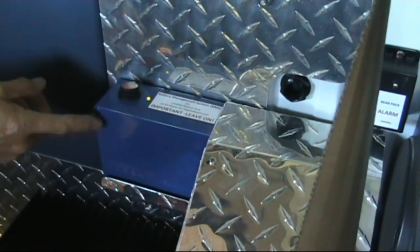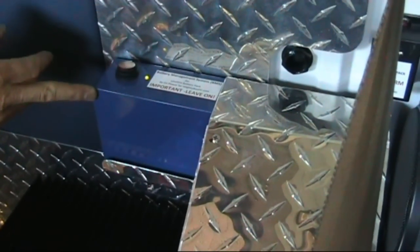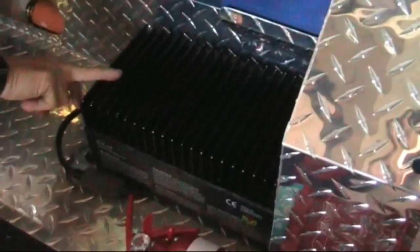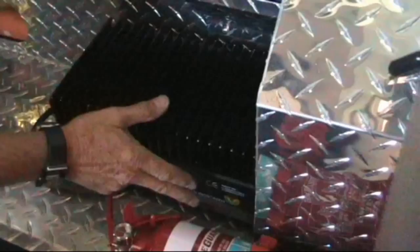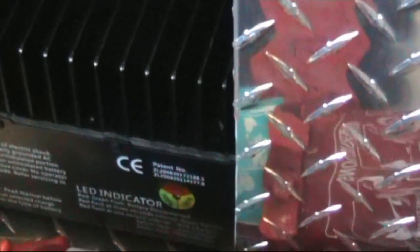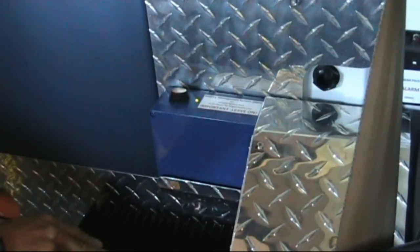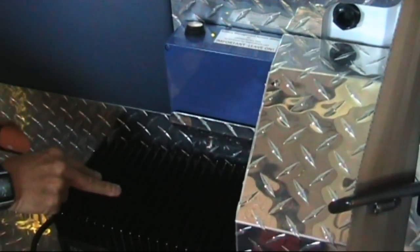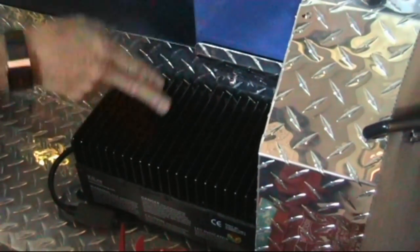You can see the battery management system controller. This controller is suitable for controlling two Alcan chargers, each putting out about 16 amps, designed for 24-volt charging. It has a little indicator showing the stage the charger is in. It takes about five hours to charge to about 60% depth of discharge on these cells. I have a second charger as well, so the controllers have been modified to control two battery chargers, allowing charging up to 32 amps. The idea was to have a 60-amp Anderson connector in the back so the second unit could be plugged in if a faster charge was needed.